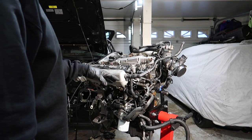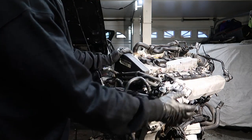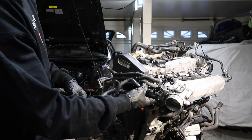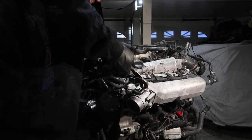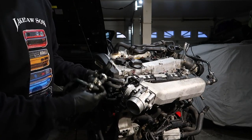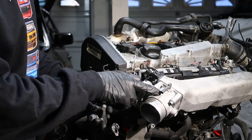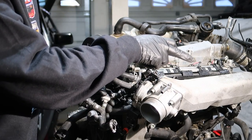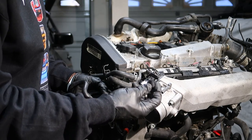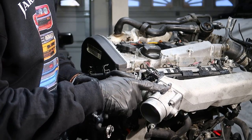Now that we're done deleting all the PCV system, we're going to move on to the EVAP. If you have your engine out or if you're swapping to a Mark II, you're not going to have much to take off — it's on this side of the engine, it's pretty much just this top piece. The rest of the EVAP would be on your Mark IV car. Taking the EVAP system off, we're going to need to cap this port that's on the intake manifold, and go back through to where we took off a couple other ones and capped those too. With your assortment of vacuum caps — you can get these at O'Reilly's or order them on Amazon — I'm just going to put that on there and zip tie around it so we have no vacuum leaks.